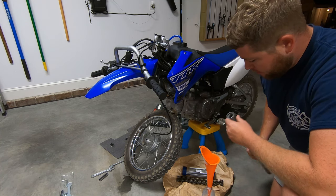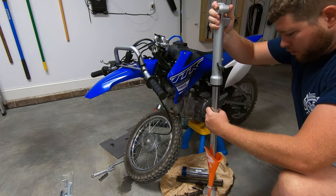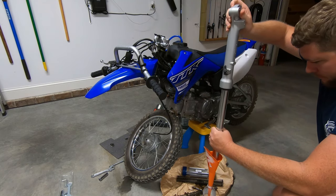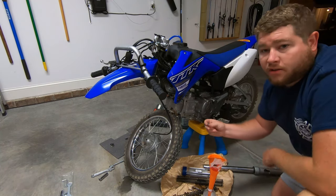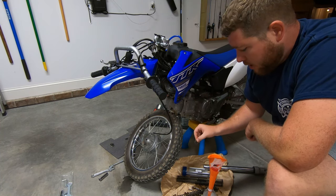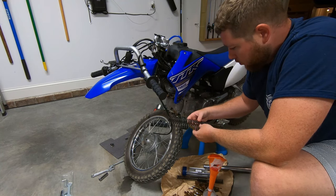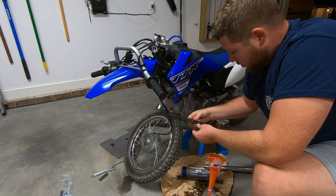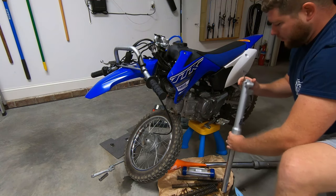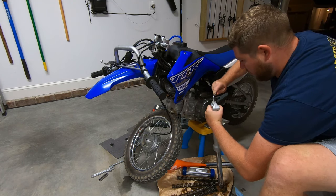We got the spring exposed — go ahead and get this out. What you want to do is compress this spring a couple times and make sure you get all this old oil out. Sitting on top of the spring you've also got this washer. TTRs have that spacer we first pulled out, so this ring is going to go between the shock and that spacer. Rule of thumb with springs and shocks: the more coils the better. You've got about double the coils on this BBR spring, so it's obviously a lot stiffer. Now we're going to get these damping rods out — I'm not sure how difficult it's going to be without a vice, but we're going to try.